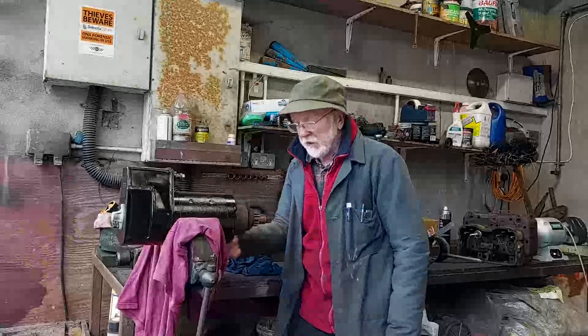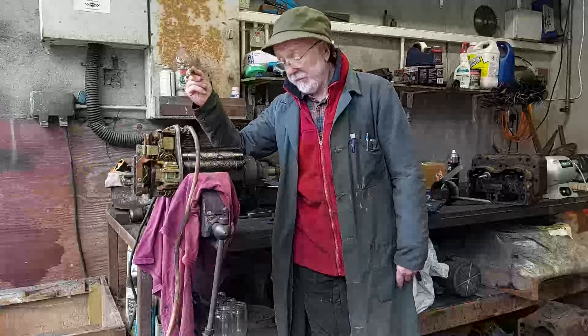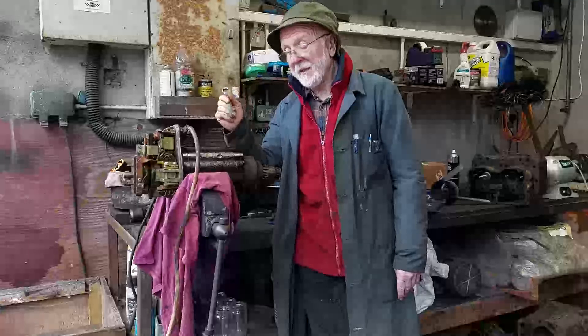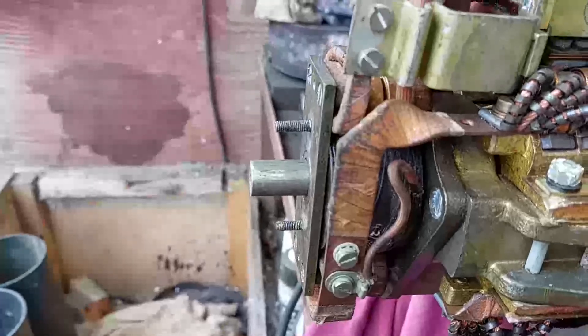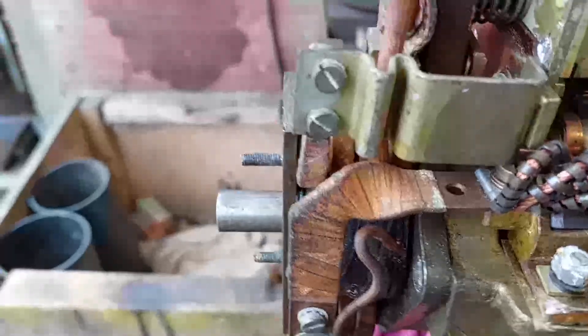Let's take the back off now and see how this is achieved. Here we see it working — we simply short a central terminal as before on the CAV. Now let's have a look at the electrics behind the lid to see what it's doing and how they achieve this bringing-forward of the pinion. It's very simple. You've got a heavy coil in here, and this protrusion here is effectively an iron core. So once this coil is activated it simply pulls that bar.